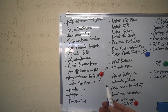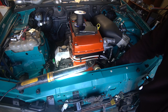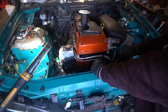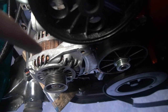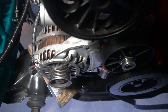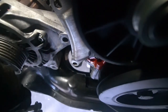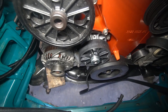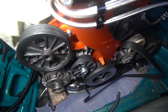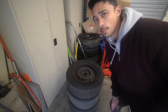Next I'm going to do the alternator bolts. The alternator is connected to the belt already installed, so first I'll remove the belt tension and take the belt off. Just down in there are the two spots where the bolts go - I didn't put them in because I didn't have any, but when I went to the wreckers last I grabbed some since I forgot to do it while the engine was out. Alternator bolts installed. I'm not going to put the belt back on because I need to access more stuff and having the belt off makes it a bunch easier.